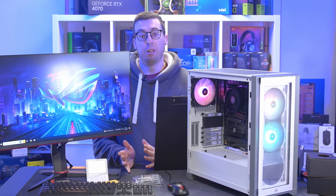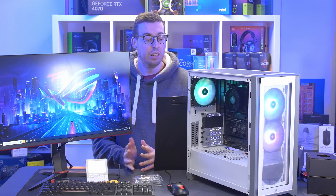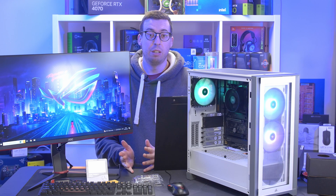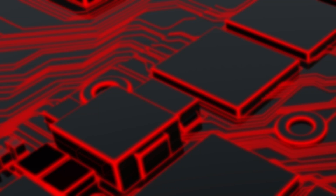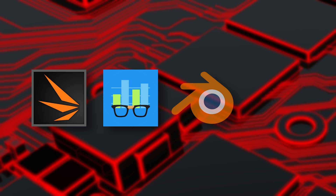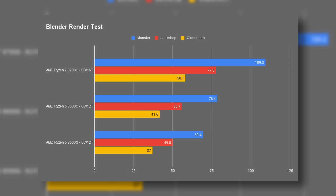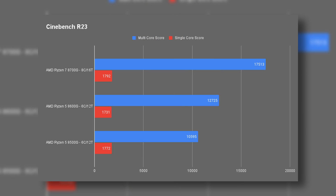I ran 10 tests — some focused on the CPU, some on graphics, some on both — and put them through spreadsheets to make graphs. For free downloadable benchmarks we have 3DMark (free demo on Steam), Geekbench 5, Blender render test, and Cinebench R23. As expected from the core and clock differences, we see an incremental improvement across all tests between CPUs, with a very nice jump in CPU score on the 8700G, where those extra two cores and four threads make a big difference.